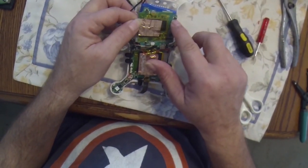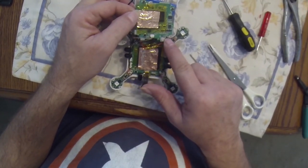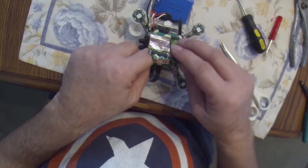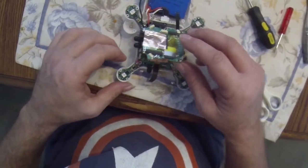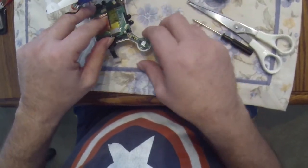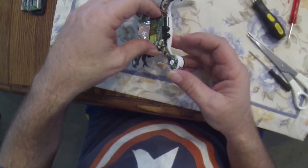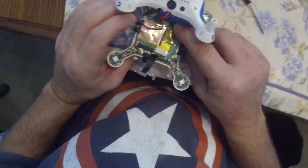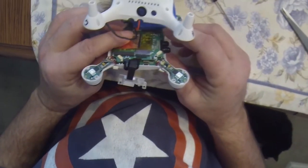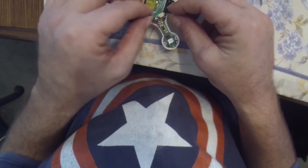On the next board that has to be reassembled, there are four six-pin receptors that have to go onto the bottom board. You'll see them all in the corners. Make sure you line that up right and then push gently, keeping your eye on where they are to make sure they're all into the spot, because they're important for the sensor board that's below it.